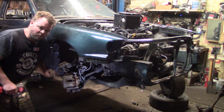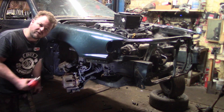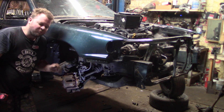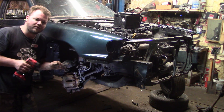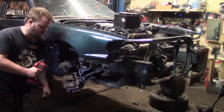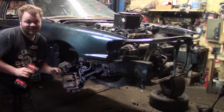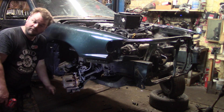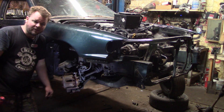Just like that — we will need to bleed these, but really not that much. You try to do it as quick as possible. The caliper has fluid in it, so your brakes are going to be a bit spongy, but they're not that bad. If you're doing race car or road car stuff, yes — but for derbies this is pretty much fantastic. You might want to bleed them a bit depending on how much fluid you lose. I really didn't lose that much, so pretty happy — and now we can fit 14s.